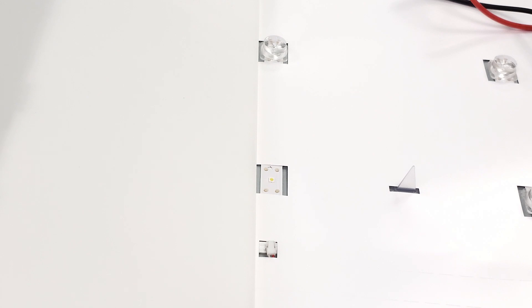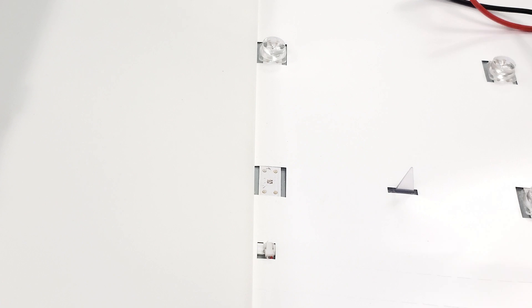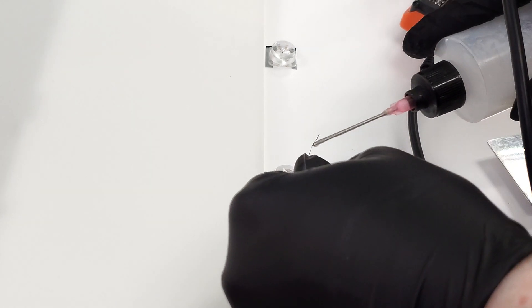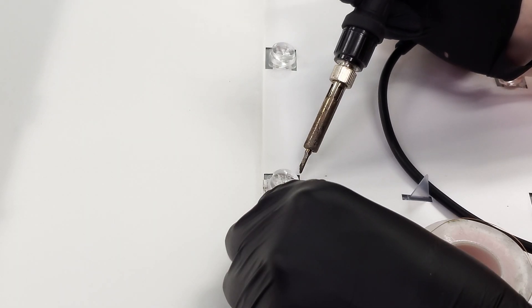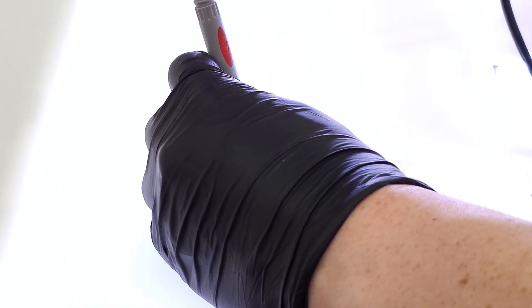You probably can't see it, but the LED itself is cracked and burnt up — and that's generally what happens. I actually prefer to use my spatula and just give it a good whack. Tin our wire a little bit, and just repeat. You want to give it a quick test. And nice — we're good.